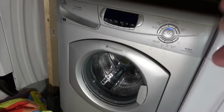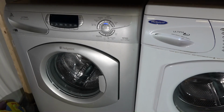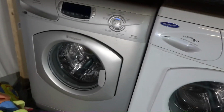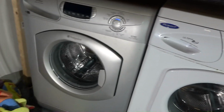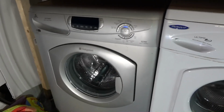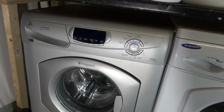And a lot of everything that you use now was shared with Indesit. The drum kind of remained the same, as well as all the cabinet and the weights and the pump, oddly enough, because the pump was still at the back. It was the same filter housing still. Still had the same back plates and all that. Same drawer. But now, unfortunately, we have Indesit programming and Indesit control boards. And I mean, both the top control board and the back control board are Indesit's.